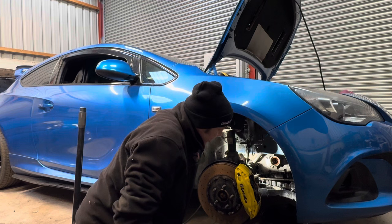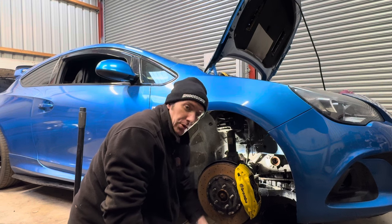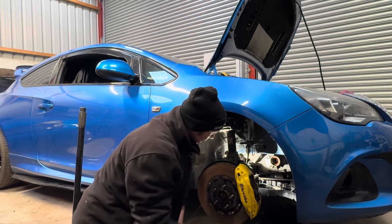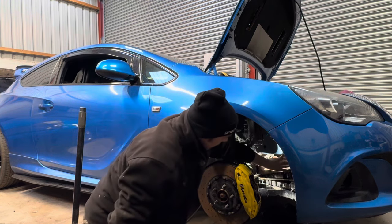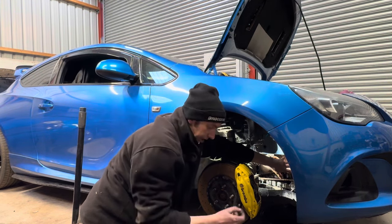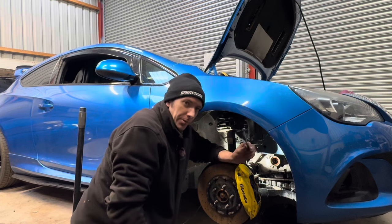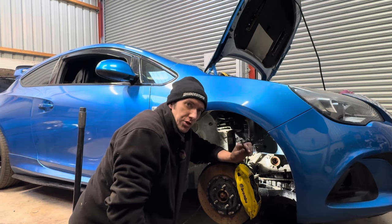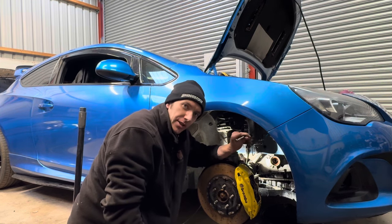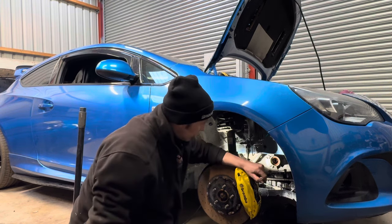Right, today we're at removing the actual timing chain casings. I've already gone ahead and removed the box purely because it's very hard to get the camera video in removal. Around the side of the timing chain casing, we have 10 10mm bolts. We also have a single 13mm bolt. The 13mm bolt can be a bit tricky to get out, so we just slightly loosened the engine mount bolts to allow it to drop a few millimetres, which allows you to get enough angle to get this one out. You do not have to remove the whole mount off the vehicle.